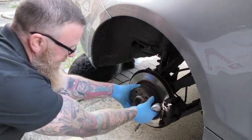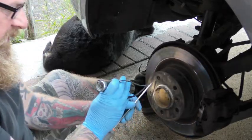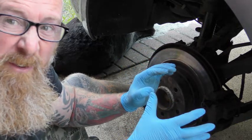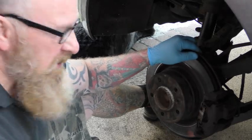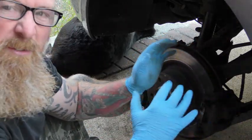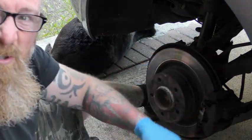Roughly this size here — I can't show the camera, it won't show you. Point the torch in there and pop the screwdriver in — small little turns — and you can feel it ticking down as you go. What you're trying to do is get it slightly stiff, then go back one tick, and then move to the other side. 50 to 80 pounds in the garage if the shoes need changing, but they don't often need it.